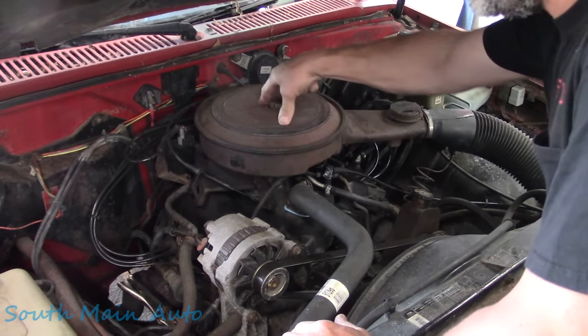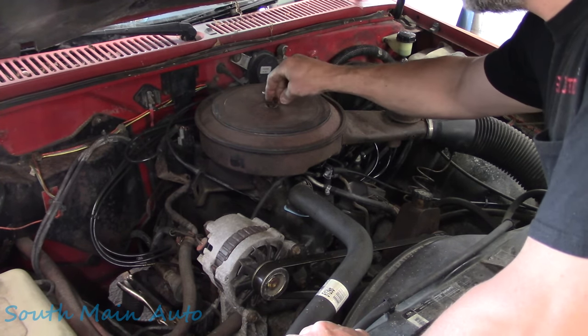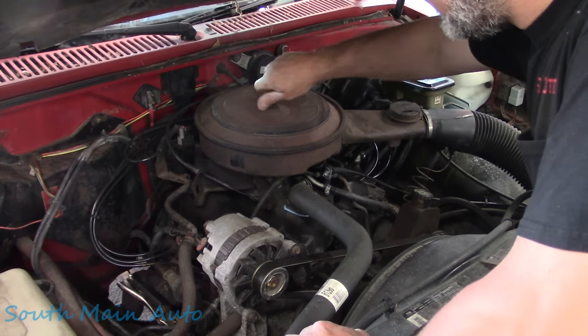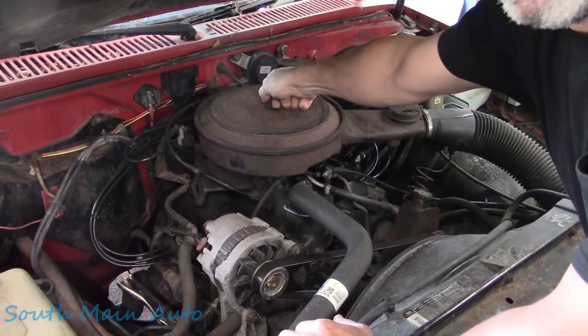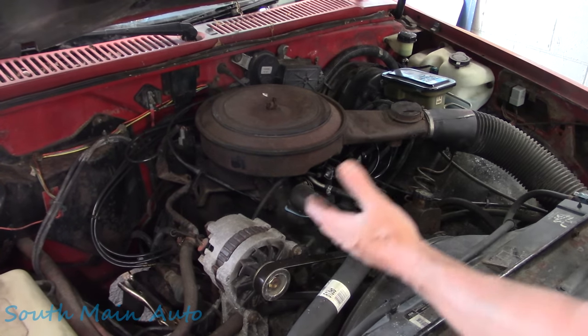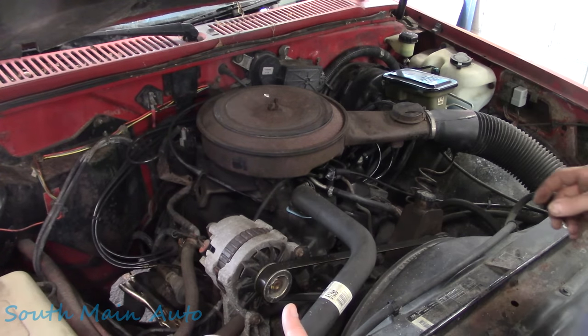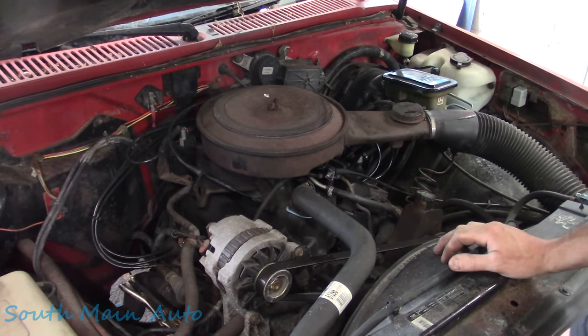Being that our O2 sensor doesn't even seem responsive, and that's going to be a key player in an old system like this as far as one of the feedback sensors, let's find it. Let's just do a bypass test on the wire, because it should be just a single wire sensor, I'm assuming, or maybe three wires. I don't know where it is, but we'll find it, rest assured, and check out that circuit first, and then we'll go from there.